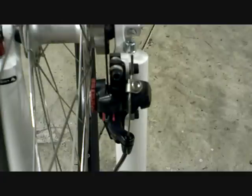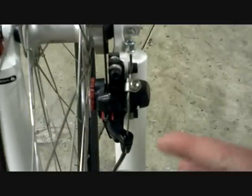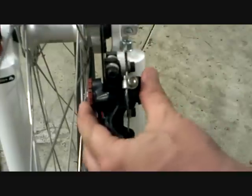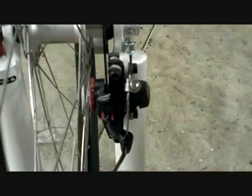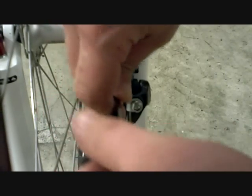All my how-tos are probably easier or better ways — this is what works for me. You don't want to tighten this down yet, as it's definitely not centered. Hit your brakes — this way you know it's centered on the rotor — and then you tighten it down.